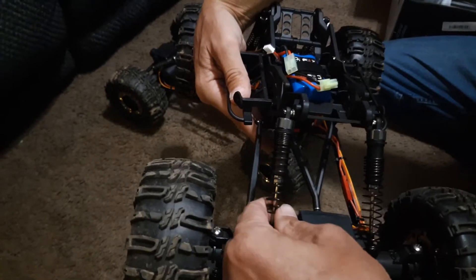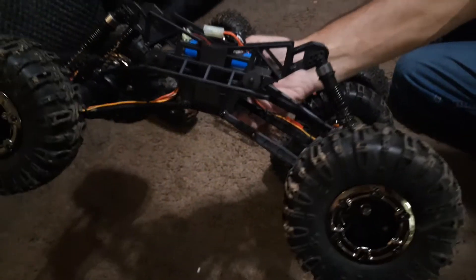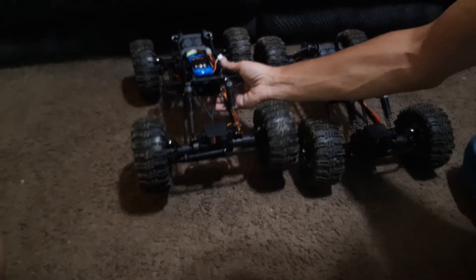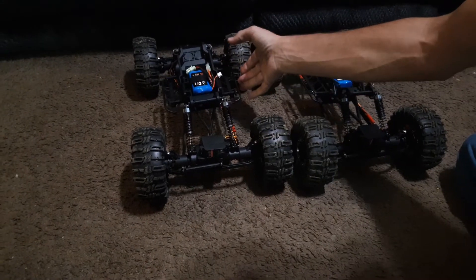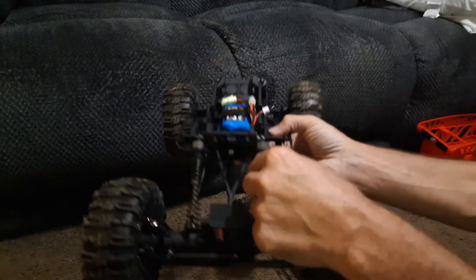This one I had to really compress to get that retainer on, but this one the retainer will come off by itself. Watch whenever it sets down — it goes to the left every time. It's always that side, can't get it to stay. It's because these two springs are all different: these two springs are long, these two are short.